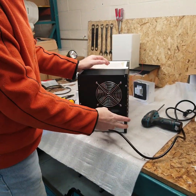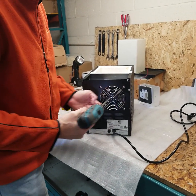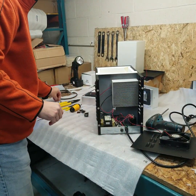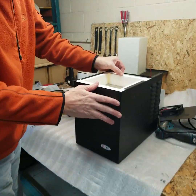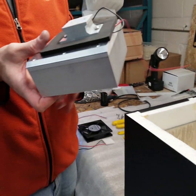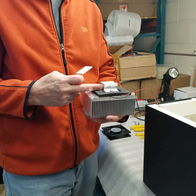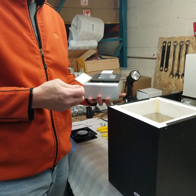On the back you will have six screws, and for simplicity we've removed four of them. Lay the back plate down. Inside there are two screws which release the heat sink. This is the heat sink, and what we're replacing today is this module that is sandwiched between this extender block made of aluminum that goes through the back wall and the heat sink which you see in the back unit.